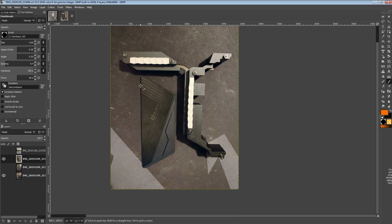And if you added thermal paste between this plate and the rest of the VRM heatsink, you've just extended how much time it takes to reach steady state. So if you're going to do steady state temperature thermal comparisons for this VRM, the test period for the system is going to end up being close to 3 hours maybe. Because if it initially takes an hour and then you add more surface area and more mass, it's just going to make the time it takes to heat up even longer.